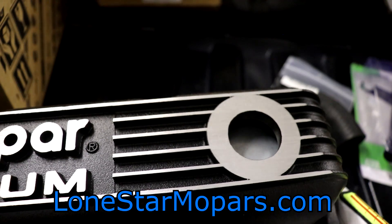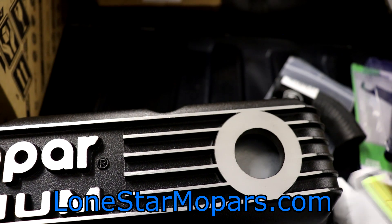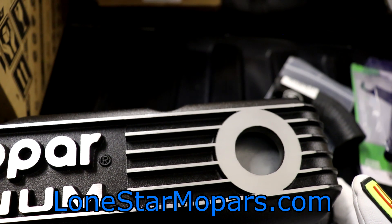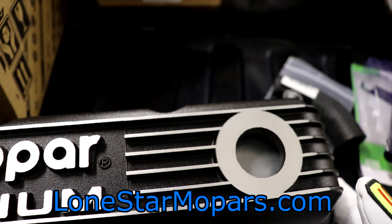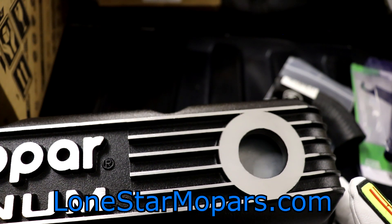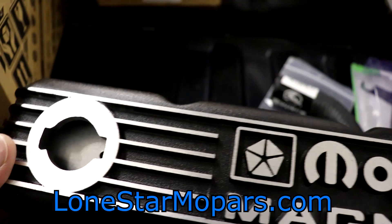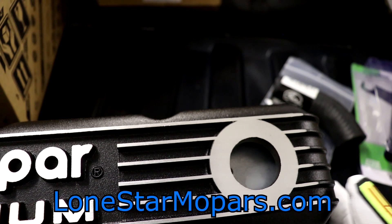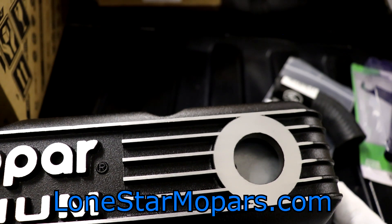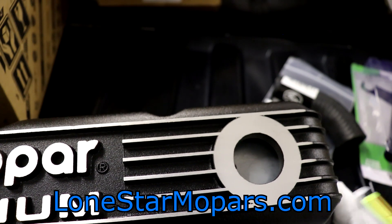Finding grommets to fit these can prove to be challenging. If you search for it, you'll find a million threads on it — very few people follow up. You tend to have better luck not only on truck-based sites but rather like the A-body guys, your Mopar backyard engineer crowd. I think I finally figured it out — I think it was a Ford number and it fit great. I was going to mike these and have everything figured out — the oil fill cap, what I was going to do with the PCV or breather, if I'm going to run a catch can, the lines, all of that mocked out for you. But I've got to get these to the machine shop because the ball is rolling. And once these are on, that means heads are on, rockers are in, cam's there — we're about ready to dyno that thing.